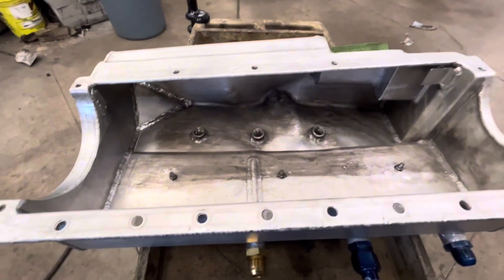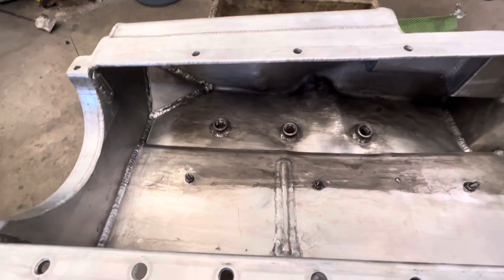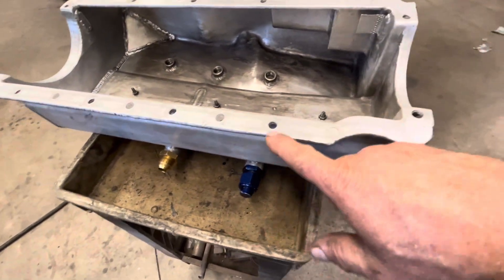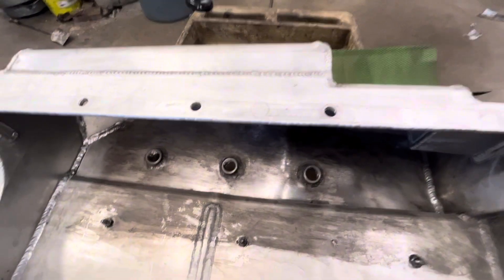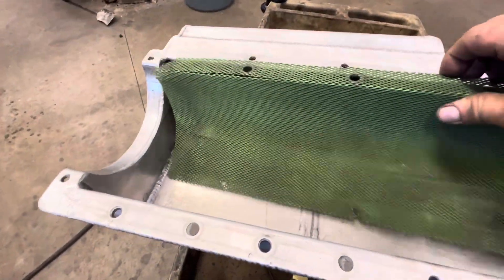That's hence 'dry sump' — the sump, the oil pan, is not really where the oil is lubricating the engine. It's all being sucked out of here. There are far fewer oil pan bolts used; every other one of these is just plugged. But you ask: on this side, how the heck do you get the pan bolts in, especially once this guy is in the way?